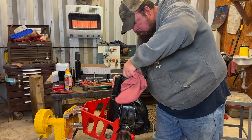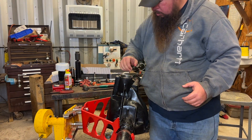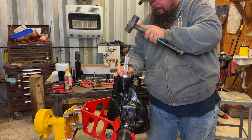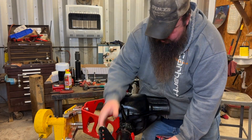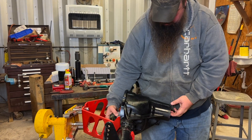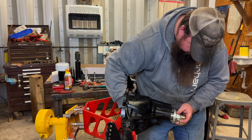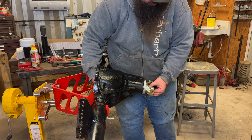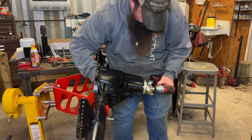For final assembly, I clean around the outer bearing race and where the Pinion seal goes, then install the final outer Pinion bearing — not the slip-fit setup bearing. Then I install the outer Pinion seal, put the Pinion in, put the yoke on, and put the old Pinion nut on just in case I have to take the axle back apart. I don't like to use the final Pinion nut until the very end after the axle is fully built.